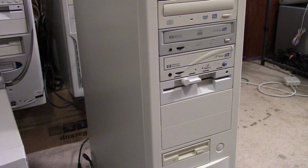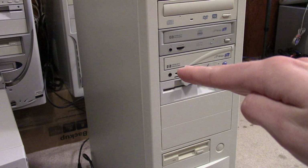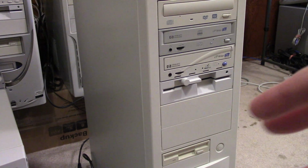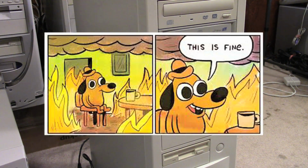You see, as I mentioned before, if the SCSI card is physically placed higher up on the motherboard, it will boot first. But the IDE card, with all the extra storage on it, the 750 gig and the 200 gig hard drive, won't fully initialize, so I won't have access to those drives anymore. So I have to initialize IDE and then restart the machine. If you do a software restart, it keeps working. It's fine, only when you do a cold start. Other than that, everything is fine.